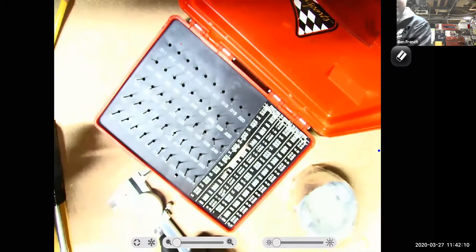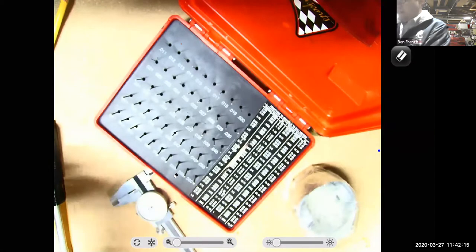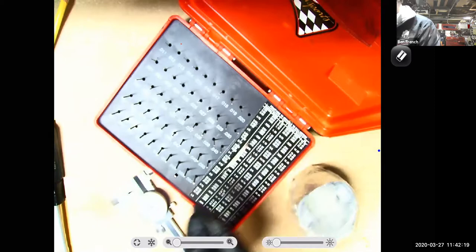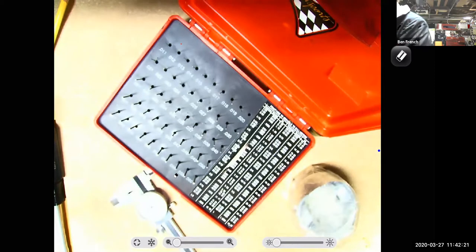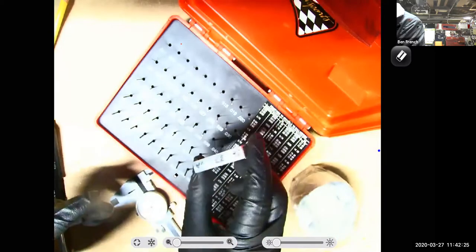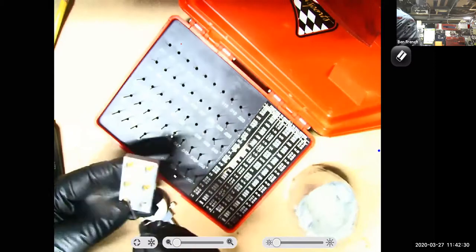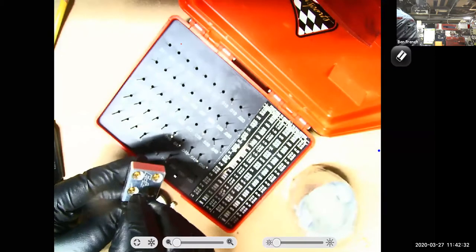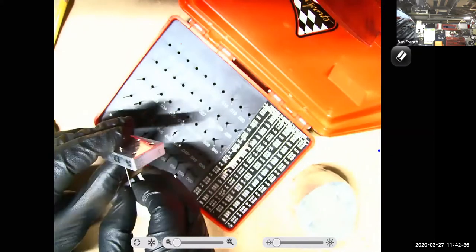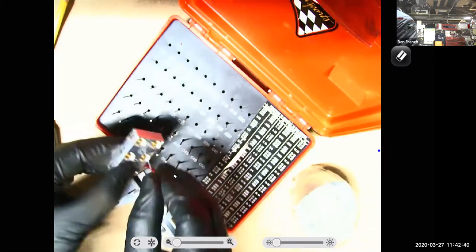Kind of like a feeler gauge. Yep, Charlie. If I spill all these out, I got to actually mic each one. And then basically what I do is I put them through my jets. Now, looks like I labeled these 36, 37. So I'm going to grab a 37 pin gauge, and that should go through that jet, in theory, if I did this correctly. Yep, it doesn't fit through that one because that's a 36.